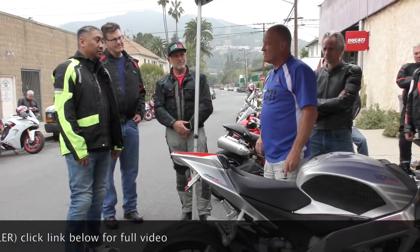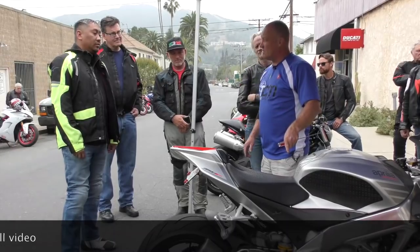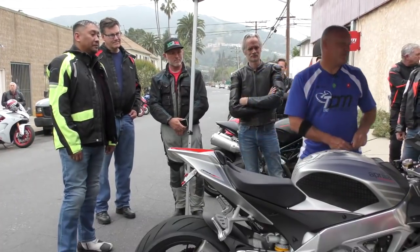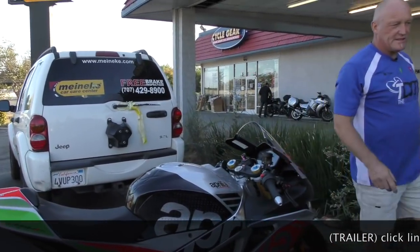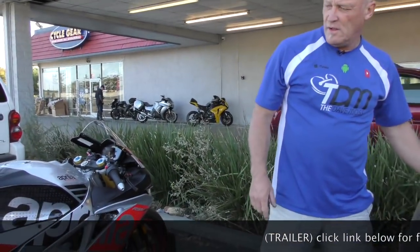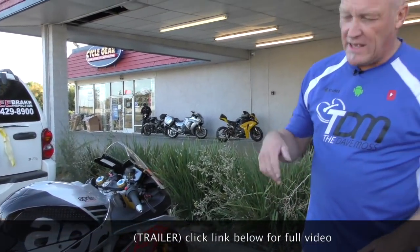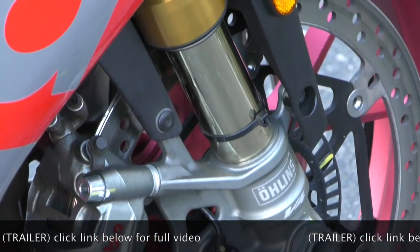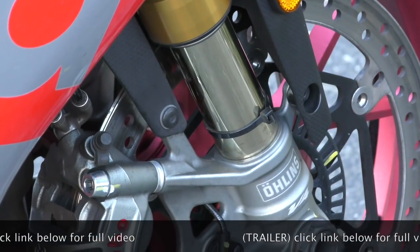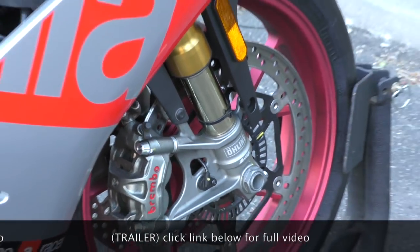Your front end's way stiffer than the rear. Do you want the front to match the rear for the road? For balance, yeah. So the owner's not here — he's a little lighter overall. Rider's weight is 200. Complaining about braking, it diving and just collapsing underneath him. How close is that to bottom? The bottom is 5 millimeters up, so it's about 15 millimeters away.